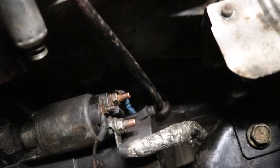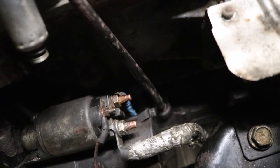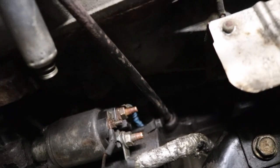After a little more drilling and using a magnet to pull out the shavings, I was able to get the dipstick tube pressed back into the block. So now we're ready to get our exhaust manifold back on and get this thing closer to getting started.